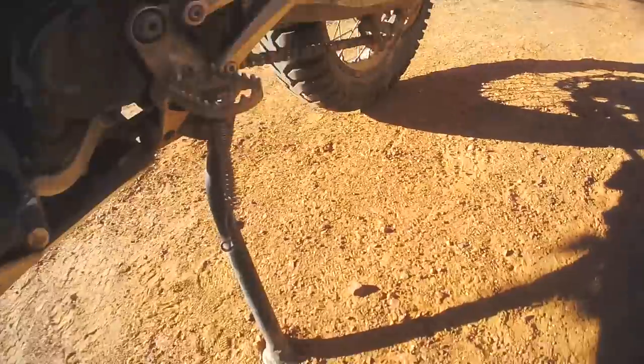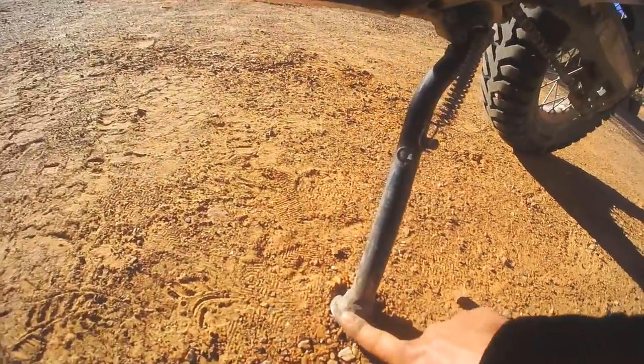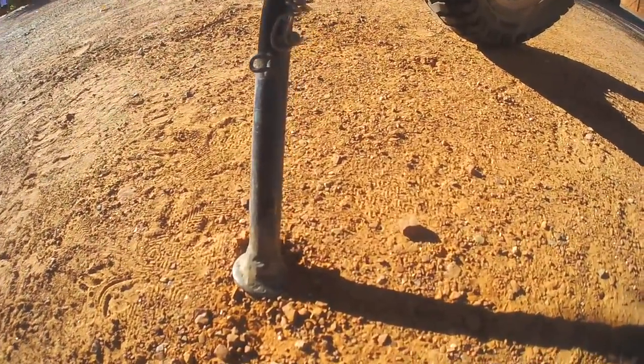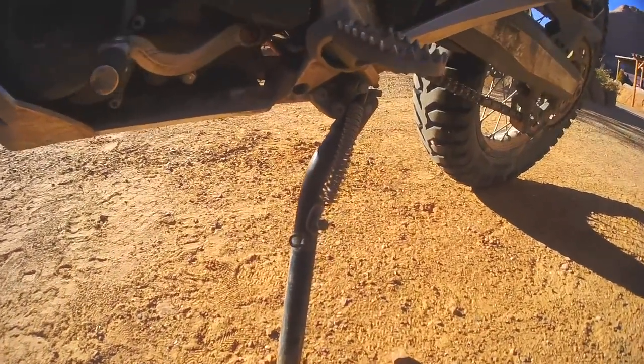We ended up having to lop about 1.5 inches off of the kickstand and then weld the foot back onto it, which I welded back on at kind of a wrong angle. Been a little bit of a pain in the butt, but it works. Never weld on the bike. It will fry your everything instantly the moment the current hits it.